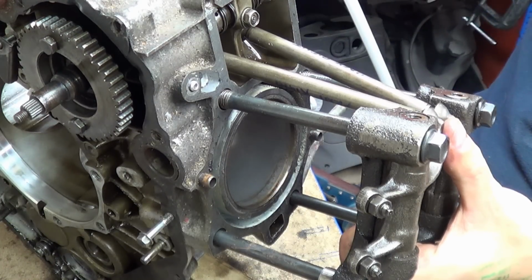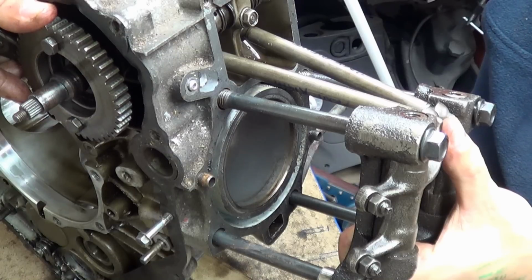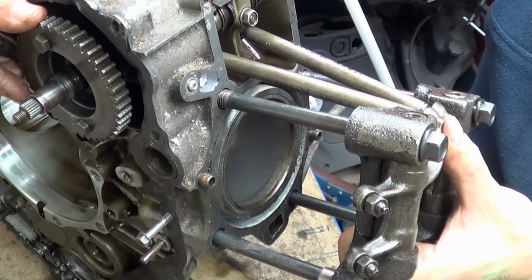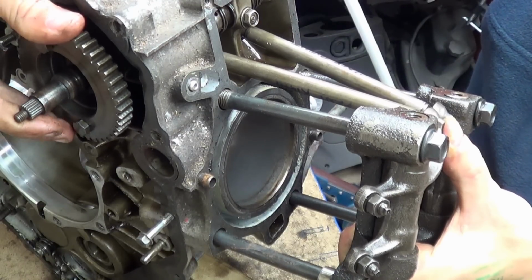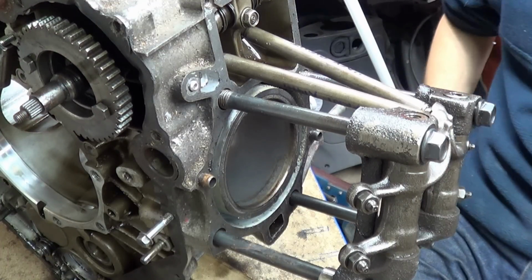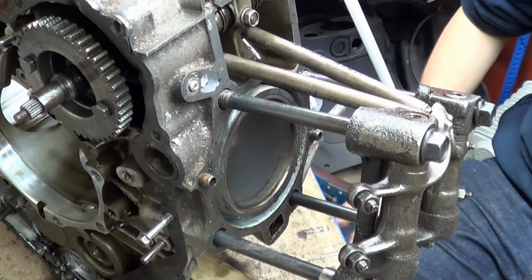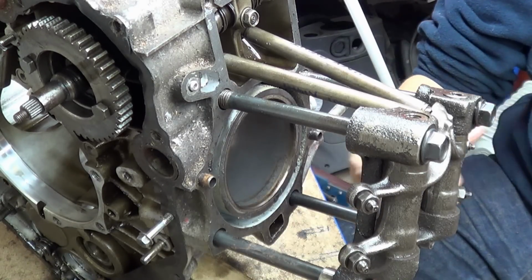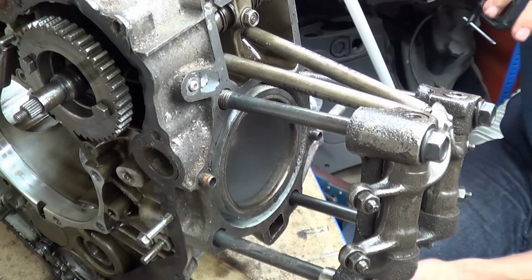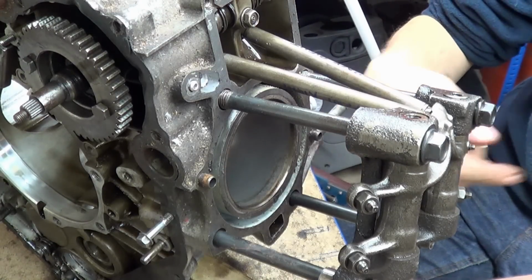Now, you'll see there's a bit, and I'll go back. There's the exhaust closing, and then just before it's reached closed, you can see the inlet. They kind of just swap places, they trade places. Very hard to see because this is all wobbly. But there's that there, you can see them trade places. And this is called valve overlap. And the reason for valve overlap is that the exhaust gases are moving out, and the fresh charge coming in is moving in. The exhaust gases need to go out.